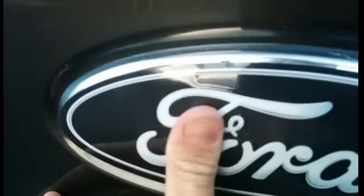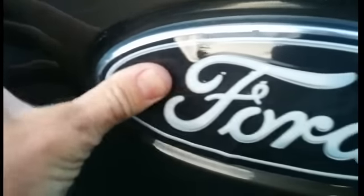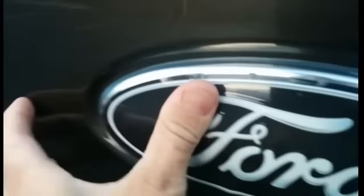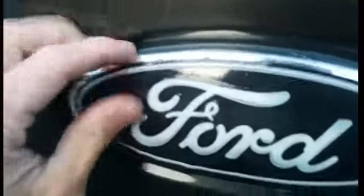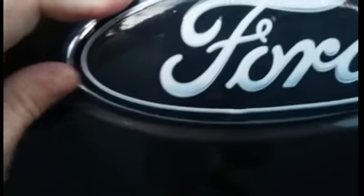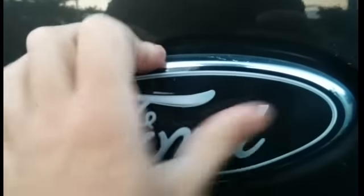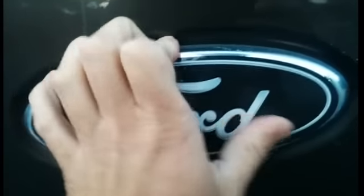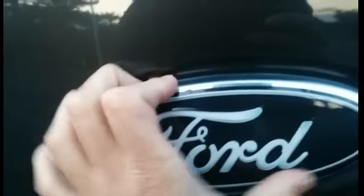And this is an air release vinyl, so as you push, it's just going to lay down. On this end, you want to push from the middle, just push out. Just press. You're going to get a couple of wrinkles, just push them out with your thumb. And just work that, like I said, from center to the edge. And if you get a little hiccup, this material is pretty resilient. You can pull it up very carefully and push it back down.